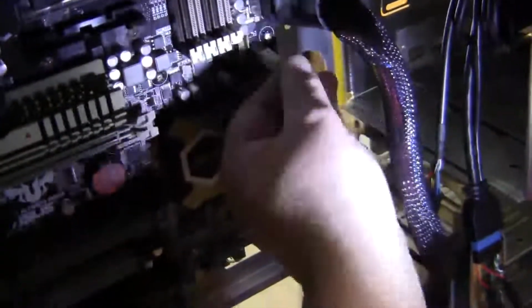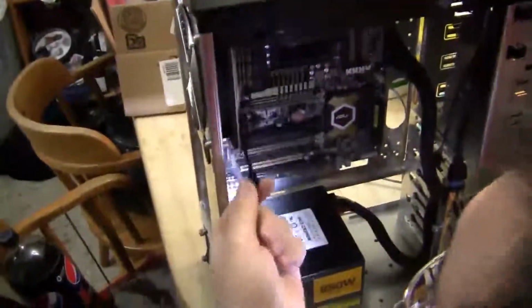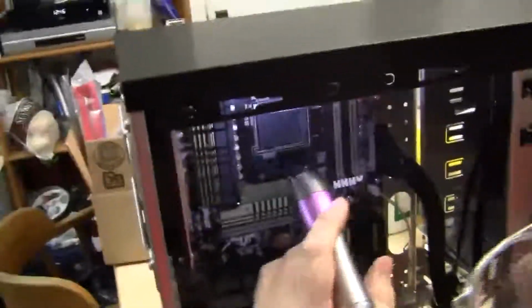Chassis fan 4. Okay, so chassis fan 4, you can actually just plug this in to there. It's just really convenient because now it's controlled by the motherboard, and you don't have to use this pain in the neck thing, because you're gonna get to a point where your wiring is just going to become a complete and total mess. Believe me, we'll get there too. And this keeps it from happening. Now, we do play the game of trying to hunt for chassis fans.